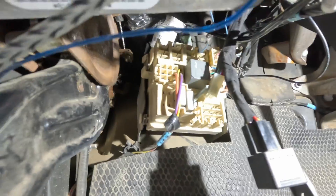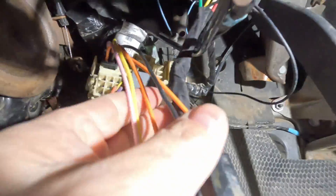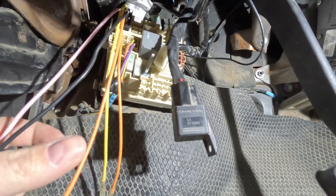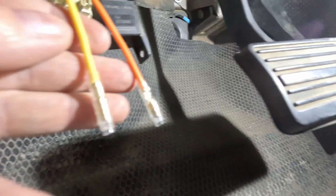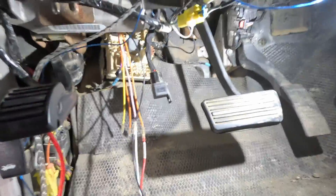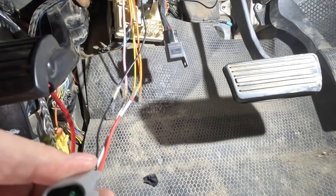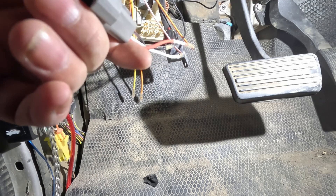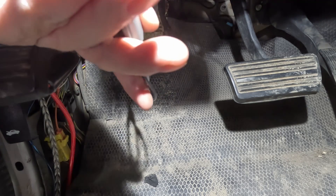Back at the truck, crawling up under the dash to plug this in for the last time. It's plugged in up there. I've left the yellow and orange wires free-hanging for now, because if I ever need another 12-volt battery connection or an accessory circuit I have access to them. Here's my pigtail for my device — black is ground and that's confirmed.